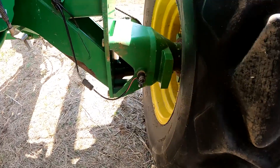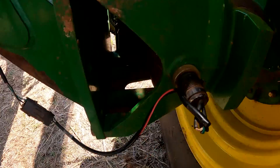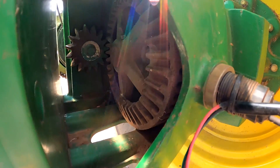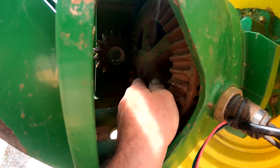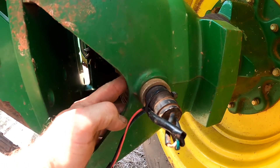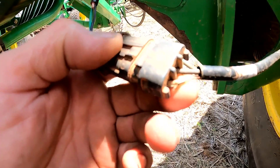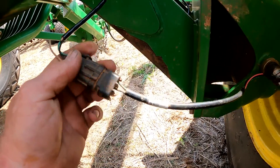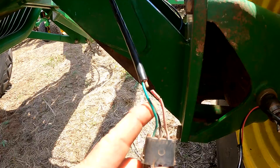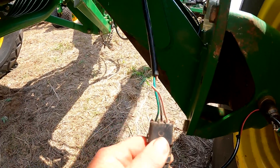We came back to the back of the cart. The wheel speed sensor is going to be on the left-hand side of the cart, on the left-hand wheel. You can see the main drive clutch on the back side, and on the front side you've got your wheel speed sensor. Keep in mind — there is a bearing in here that runs on this gear, and I have had that bearing wear out and rub the sensor, causing it to become damaged and not read speed anymore. But looking at this, we found real quick that the wiring going to the sensor is not in really good shape, and we've got a broken wire — our power wire to the speed sensor on the cart side.